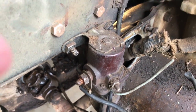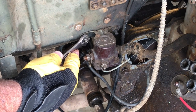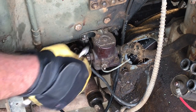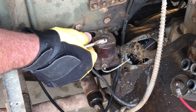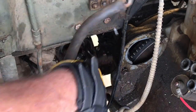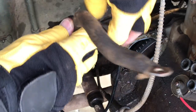This solenoid has been mounted by drilling through the firewall with simple screw bolts. The solenoid mounting is not actually something new — a lot of guys like to have a simple key start as opposed to the floor switch. But we're going to put this back to factory, so I'm going to remove this solenoid and put it on the shelf. It's just a standard solenoid — that lead would have gone to the starter, and that lead would have gone to the ignition.